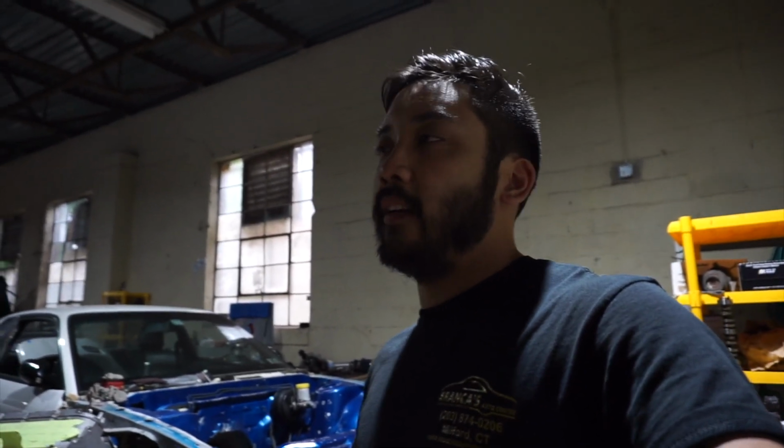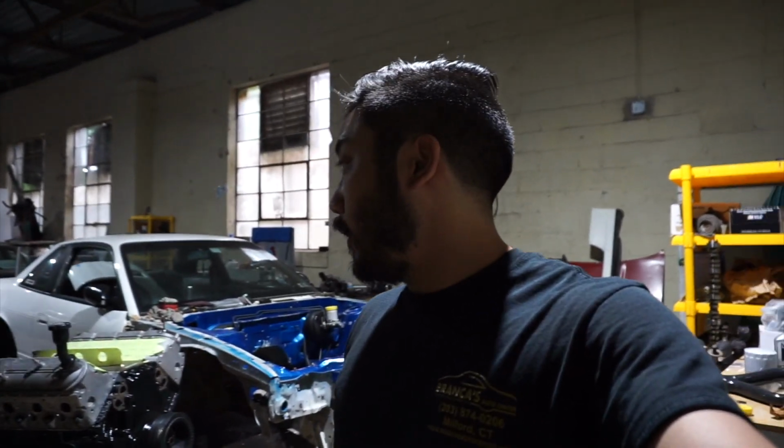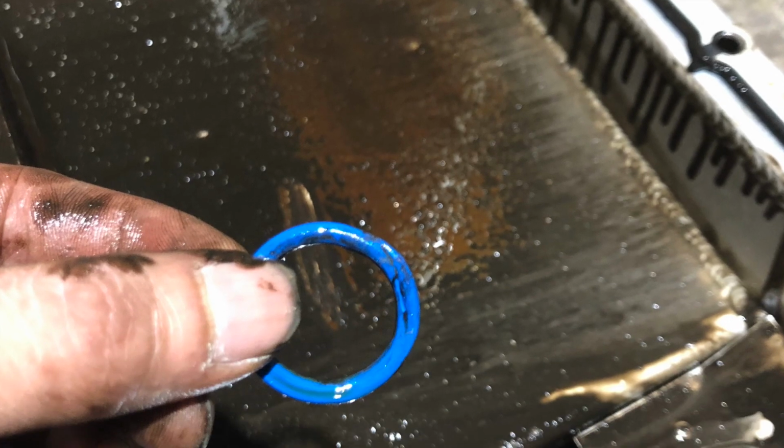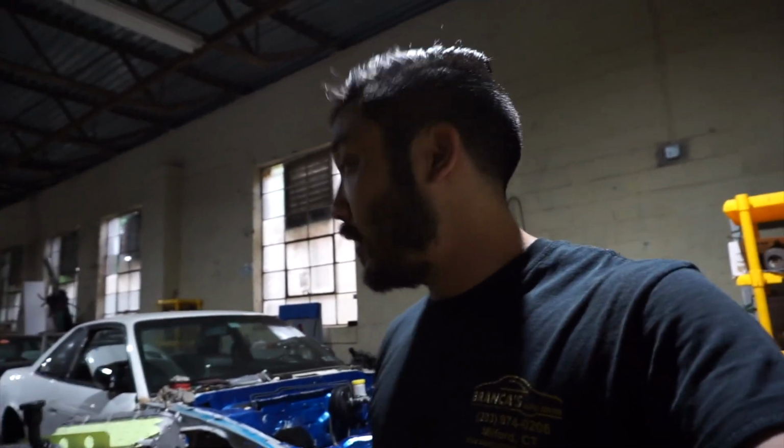So I took the car home, and within the weekend, we pulled the heads off and no bad lifters. Decided to dig in a little more. I pulled the motor out, gutted it. Found out that the previous owner who had put the motor together had two O-rings for the oil pump pickup tube. And one of them was pinched, not like it matters because it shouldn't have two O-rings in there anyways. So no oil pressure, trashed the bottom end, rod knock, you know, the whole nine.